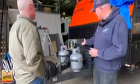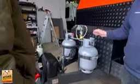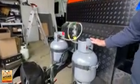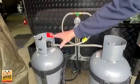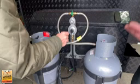So let's start off down this end of the caravan with your 2 gas bottles. These are already filled with gas, ready to go, so you can start camping on them straight away. Now, what I have done is I've turned them both off, so the gas is ready to travel. Up here, you'll notice there's a little green lever. At the moment, it's pointing to this hose here, so what that's telling you is it's taking the gas off this bottle here. When you exhaust the supply of gas in this bottle, you can turn it over, and then it goes on to the other. Then you can run on the other one.